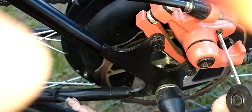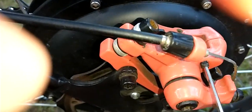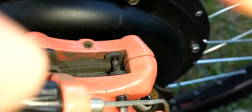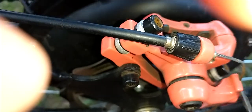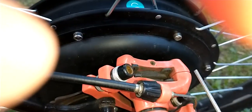These are apparently ETX pads — I'm not sure, I'm not an expert on pads. This is the first time I've ever changed brake pads on a bike. As you can see, the pin moves out of there — put it somewhere safe — and now you can use your same Allen key to come in here and pick up the pads.